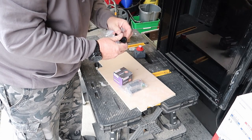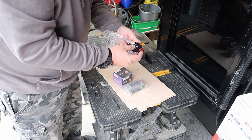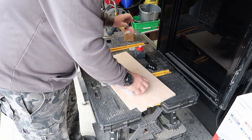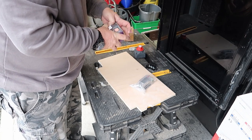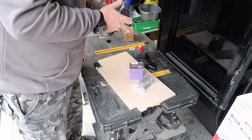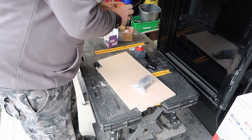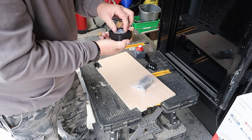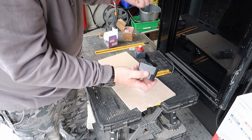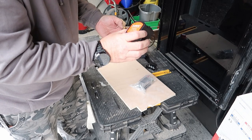That's the fuse holder that goes between the battery, the leisure battery, and the VSR, voltage sensing relay, or split charge relay, whichever way you want to call it. And that is your Durite voltage sensor relay. Comes with all the bits you need. That's the earth wire. Durite are good, proven, so I use them for that main reason.